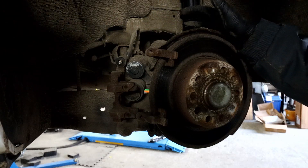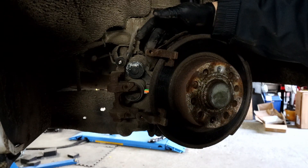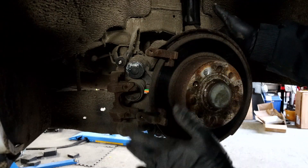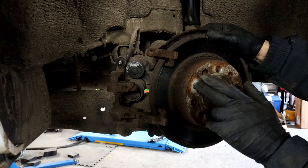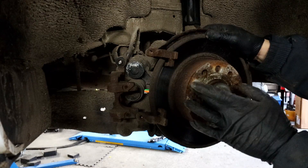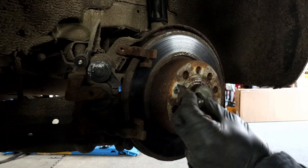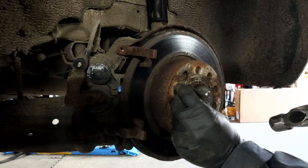Now we will have to remove the carrier in order to replace the discs. If you're just doing the pads, all you will have to do now is just wind that back in, clean the locators for the pads to make sure it's nice and free, and just fit new pads in there. By the way, I forgot to tell you — make sure you undo the disc retaining screw while the caliper's still on there. It does help because when the handbrake is on you can undo it easier. Or if not, just tap it and use an impact gun to undo that. It's a Torx 30, by the way — that's the tool you need for it. Put it on there and give it a good tap to free it off.